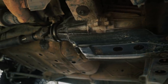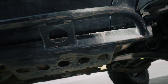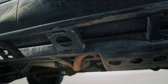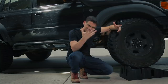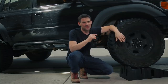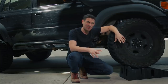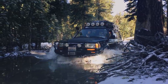Your differentials are pretty durable but you can break them, so a lot of folks will have armor on their differential, armor on transmission components, armor on sensitive bits under the engine. My sliders happen to incorporate a catalytic converter armor plate, so when I got my sliders I also added that armor. Go under your own vehicle and see what hangs down low and see if there's an armor plate for it.